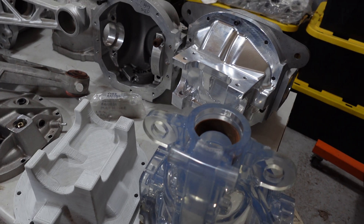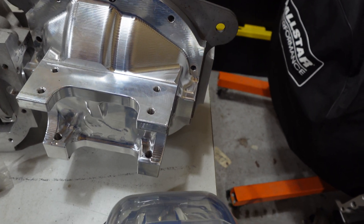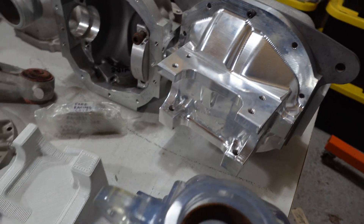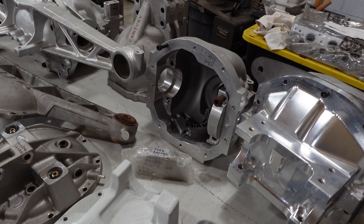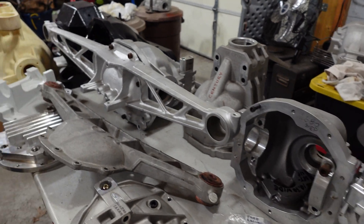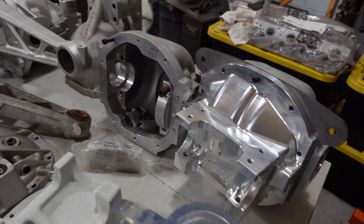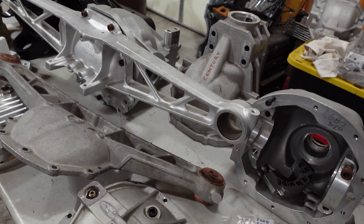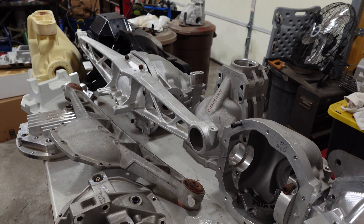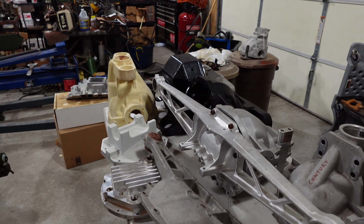What you're looking at here is a lot of time and money. We've sold probably 100 to 150 units out there in the world now, but we're just ready to release this. This Corvette version is about to go into a car and we're really excited about it — it uses Drag Vet suspension and it's also an option for Detroit Speed suspension for the road race crowd. For anybody building an IRS car, there's a lot of stock stuff in the junkyard but that's drying up, especially with the 8.8 stuff. In the Corvette's case, they just had 10-bolts and were machining down 12-bolt gears, so we're trying to address that by offering a full 12-bolt or 8.8 Ford gear set. Thank you for your time — this is Jeff Lee from Hammerhead. Any questions, leave them in the comments and I will get back to you.